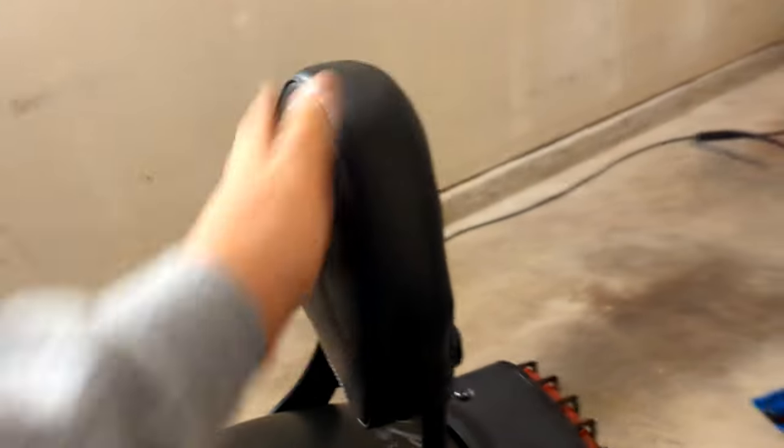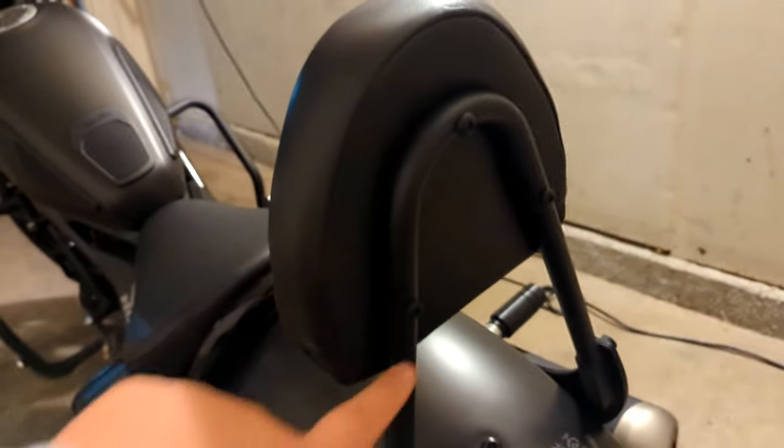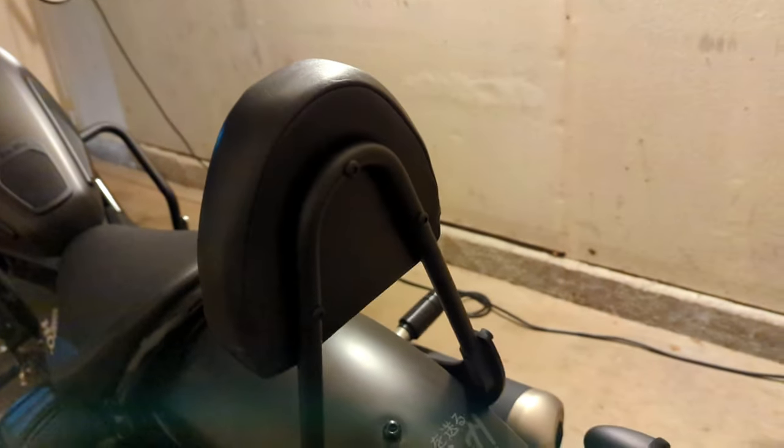Something I recommend keeping in mind during installation: the screws attached to your fender are very hard to get out, so make sure you have good leverage. Once you hear that loud pop, you know you've loosened the screw. Each screw does come with a spacer, so make sure you put it on before inserting them. It took me around 30 minutes and it was a really straightforward and easy installation overall. If you don't want the backrest on your sissy bar, it is removable — just unscrew these three screws and it slides right off.